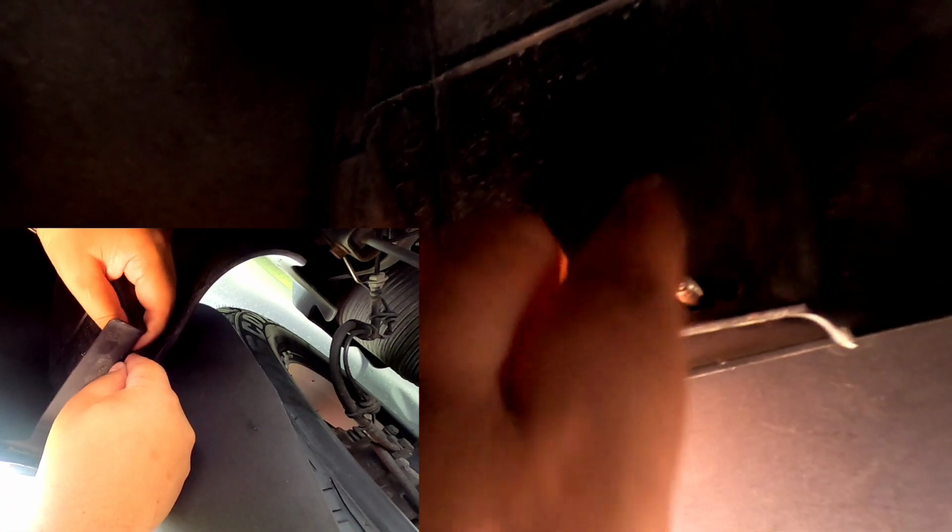So what you have to do is, notice I have a spacer in between here. You have to put the washer on the screw, then the spacer goes between the mud flap and this. And what I did was I took the OEM insert, I'll put up a picture or a little video I have, and I put the insert behind this and ran it through this way. So now when I put the screw through it, it widens the insert so that it won't back out.